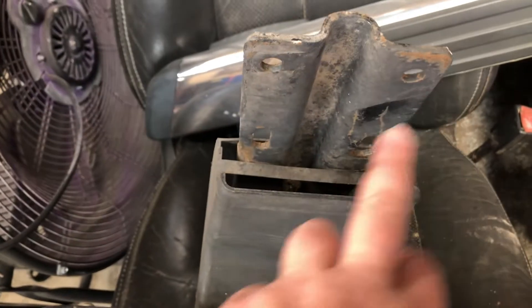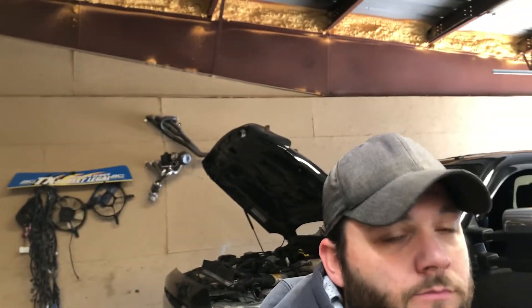In a previous video I showed you guys where the cab was all torn out. We're gonna bolt the running boards up, but the mounting points were all screwed up — actually worse than we thought. I thought it was just the two lower bolts that were ripped out, but there are four bolts per leg on the running boards and three legs per side. Four out of the six legs on the truck were just destroyed. The upper ones are real bad — they've actually torn through the cab sheet metal. We're having to weld in some plates. They apparently sunk this truck pretty good in the mud at one point, which is probably what tore the running boards all up.